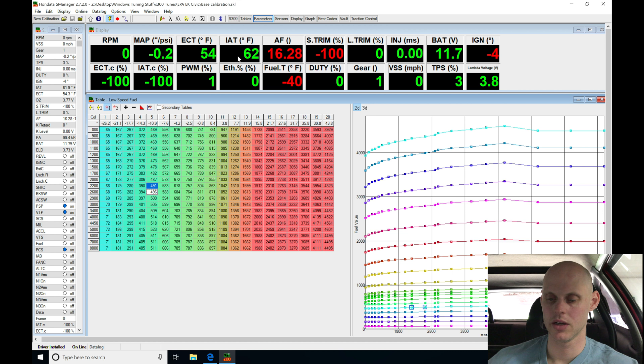Moving across, we find our air-fuel ratio showing 16.28 on the display, with my gauge showing full lean — there's going to be a discrepancy in the readings we'll see when we fire it up. We've wired into pin D14, which is the primary O2 sensor voltage input pin, and it's showing 3.77 volts — essentially full voltage. The wideband is at full lean scale so it should be at 4.5 volts, but on the D14 input we're not able to read anything higher than approximately 3.77 to 3.8 volts.